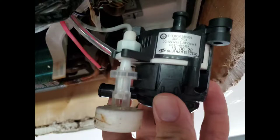The pump also has a tube — you can see it there — with a wire tie holding it on. You're going to take that little rubber tube off and basically suck it out with a vacuum. There's a check valve right after that tube that stops any sediment from going further. You definitely have to get whatever's in there out so that your pump is able to push the water through and down into the drain.